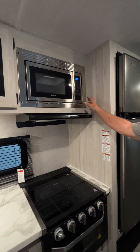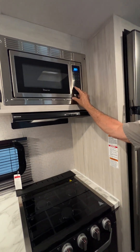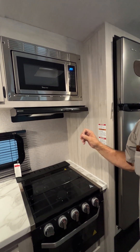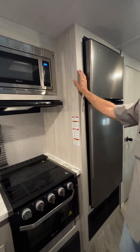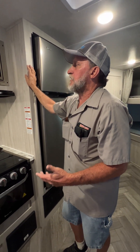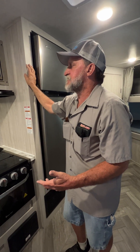It does have a clock button on the microwave. Hit the clock sign, set the time on the clock, then hit the clock again until the two center dots are flashing. The reason I set the time on the microwave is you can tell if the trailer has lost 110 power coming to it if it doesn't have the right time.